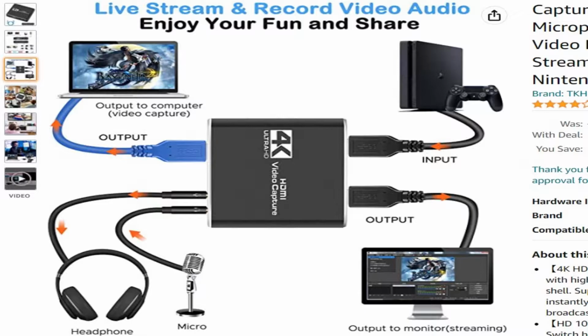The crux of all this is you then take the included USB cable and run it from the card to your computer. This is extremely important. This is how the data is actually being moved to your stream or recording. You will still need to use software like OBS to identify and capture the content being output by the card. So just think about cabling logistics between your PC and your console if you're setting up your recording rig.